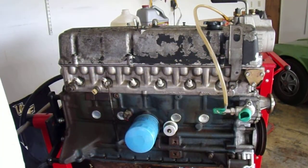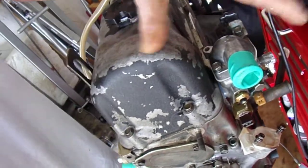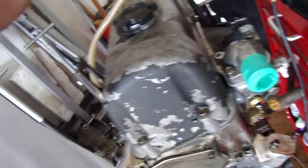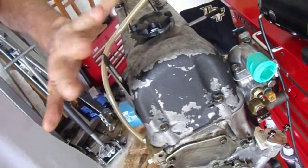Same stuff I had from my last video — I went ahead and installed the thermostat housing on there, sealed it up. That was a better solution I think to sealing up its entirety. I pulled a vacuum on it after pinching off the black hose and it worked great, so I know I've got good integrity as far as my total system is concerned.